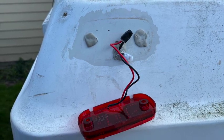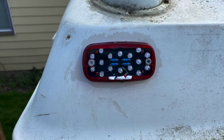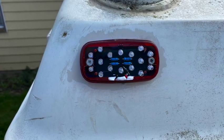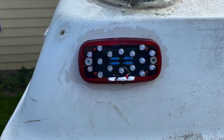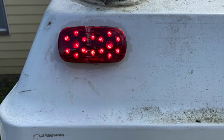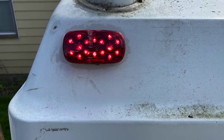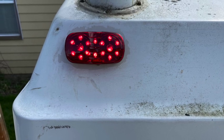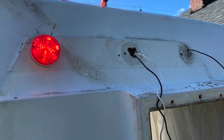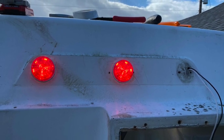We're putting the finishing touches on the running lights. I put some butyl tape in the screw holes and wire holes to keep it watertight. These shots also show that this van does need to be repainted at some point. I wanted to do it before finishing all the lights, but I think I just want to get this thing going and tackle the paint job in a couple of years. The back end has some bigger holes and lots of screw holes from lights being replaced many times.